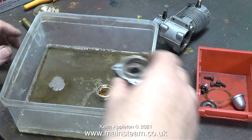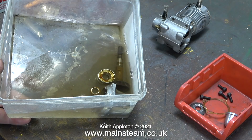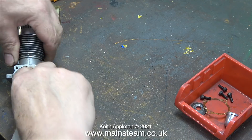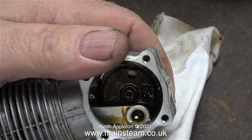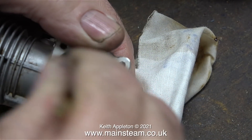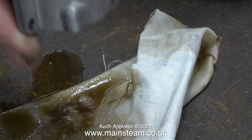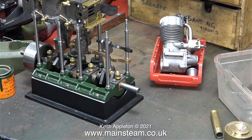This is followed by the prop driver and the small collet that holds that in place. I also dropped the front part of the crankcase into the mix as well. Using some gun wash with a paintbrush, I gave the internal part of the engine as good a clean as I possibly could. Apart from being very badly gummed up with old oil, the steel parts were quite rusty. As this is an old engine, the oil could be castor oil - thinking about it, it does smell a bit like that. Either way, you would expect the oil to be fairly gummy on an engine of this age. After giving the parts a good clean using gun wash, I put them in the plastic box.